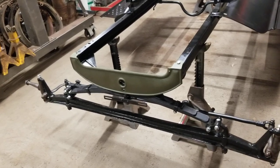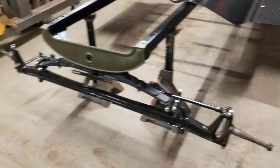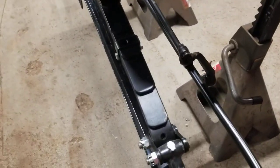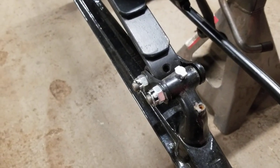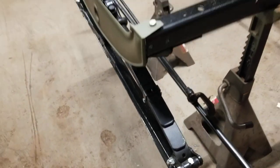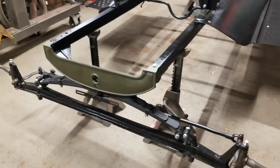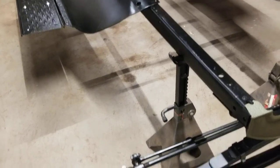They had put it together backwards, so I had to take it apart and fix it up. There was no steering on it either. Most of the steering components came off the 1923 frame — the second Model T we bought. You have these little witness marks here from where they chucked these things up in the lathe, and you have to pay attention to how you put those spring mounts in, because this is how they built in the caster. These can actually be installed backwards — if you flip it around your caster would be really wonky and the thing would be virtually undriveable.